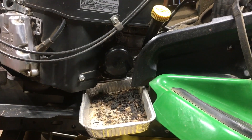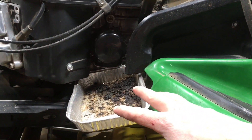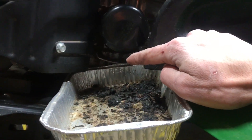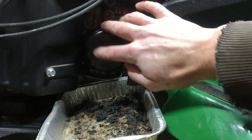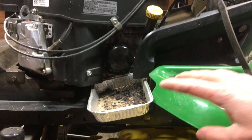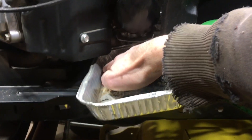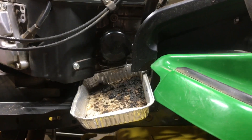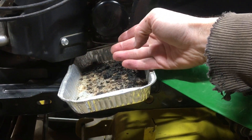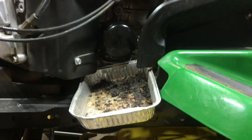I have loosened the oil filter to just hand tight so I can unthread it by hand. What I have here is the drippings tray from my Weber gas grill — it's just the right size to slip in underneath that little lip so that as this filter gets loosened the oil that spills will be captured here. This one has a square edge compared to a round pie tin, and that square edge fits up against the side of the engine block. I highly recommend doing this to prevent mess when changing your oil on one of these.